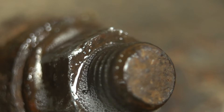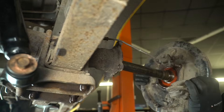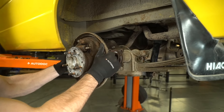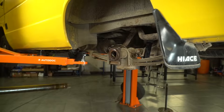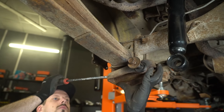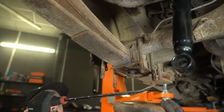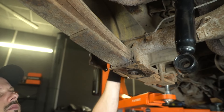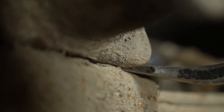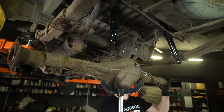Now I have to unscrew something that hasn't been touched since it was manufactured. I take out both half shafts and unscrew the leaf spring plates, removing their U-bolts in the process. Finally, prying up the axle with the mounting lever and dismantling it.